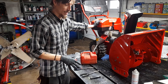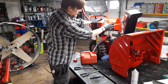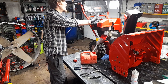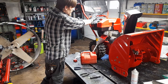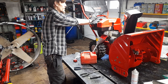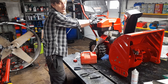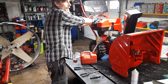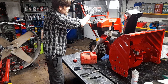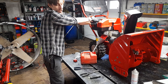Right now we're draining this ethanol-based gas. The unit runs fine right now — it needs an electric starter. Since we're potentially at the end of the season, I'm going to either refuel it with Aspen 4, which is the Swedish product, or we're going to refuel it with the 4-cycle TruFuel — both of which are non-ethanol, high-octane. One's an alkylate fuel, one's a hydrolite fuel, if I'm thinking of the terminology correctly. The Aspen 4 is a newer product we just received, and TruFuel is tried, true, and trusted.